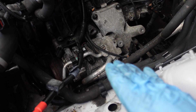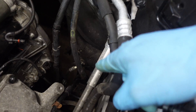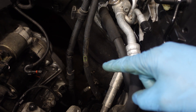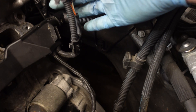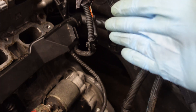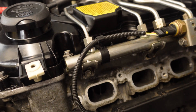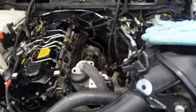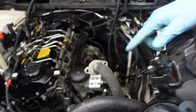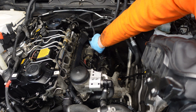First, I just want to make sure that all of the wiring is out of the way. I have the fuel line here prepared to be reattached onto the manifold, and I also have this part of the wiring harness to this side so that it's not in the way. I've also put this wire all the way to the other side. I'm now ready to put in the manifold and I have to make sure that this hose here fits underneath this part of the wiring harness.